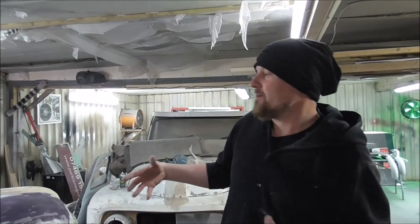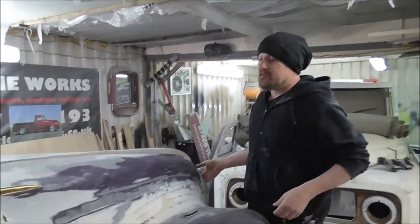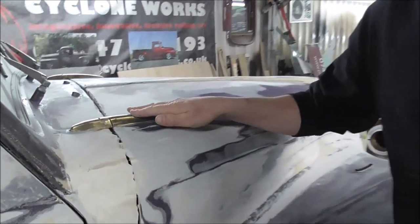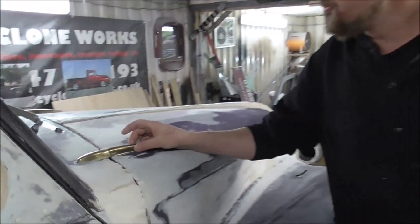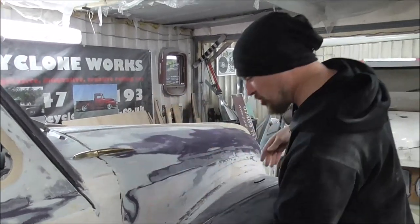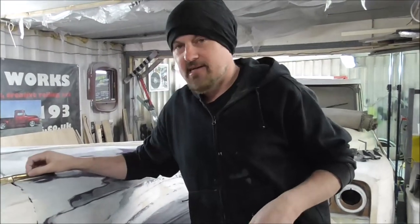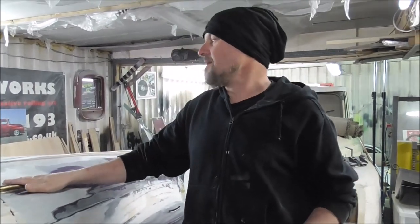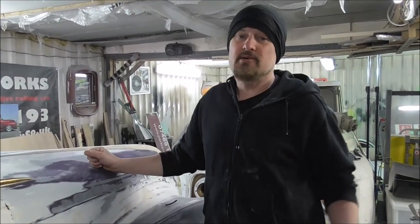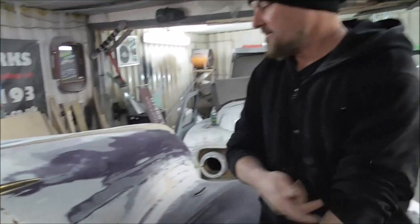So moving to the bonnet, which I've cut in half before, but now I've bonded it back together, everything's dry, and I've hung the bonnet — it actually hinges and works. The hinges I've used are hinges off a Mini door, and the Mini's got a bit of a curve, and so does this bonnet. They sit nice and straight — sitting on the kind of curve they should be on, looking good. They look really factory, which is nice — it's an Austin A40 and the Mini was obviously made by Austin, so they look right for the period.